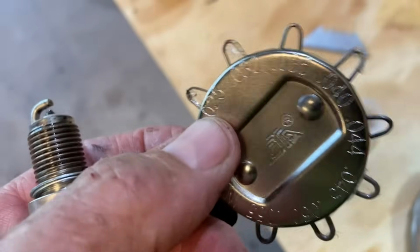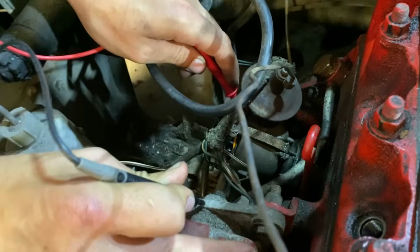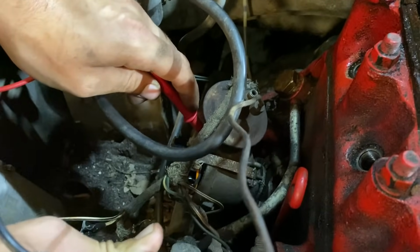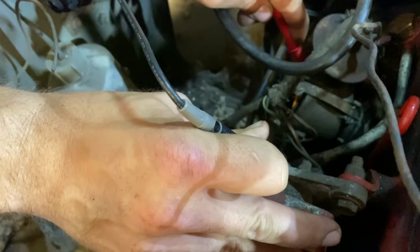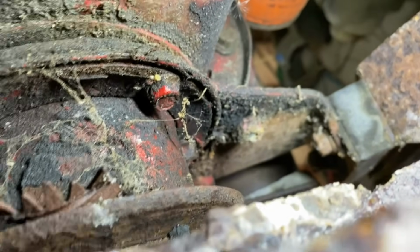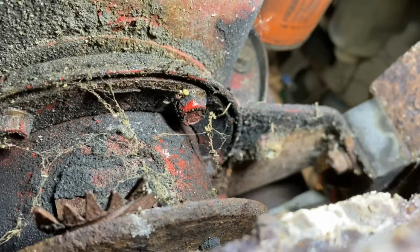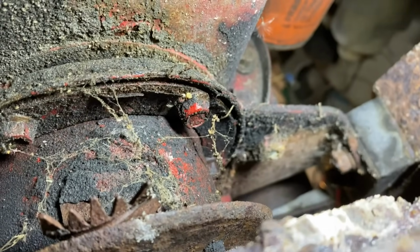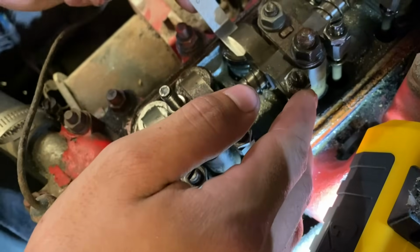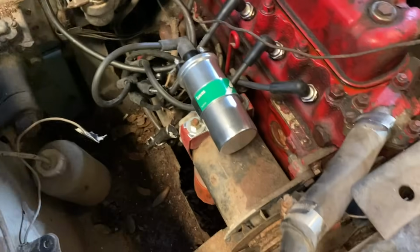Regapping these plugs. They're supposed to be 25 thou. Dan's gonna hold these contactors on the points, and we're gonna go till they open. Okay. And now I just gotta go underneath and see where we ended up. So it's supposed to be 3. Advance the timing, which means turn the distributor clockwise. Dan's checking the tappet clearance at 12 thou. Lucas, prince of darkness. Ignition system's all together.